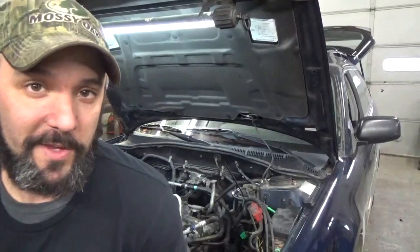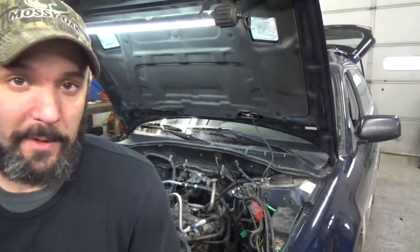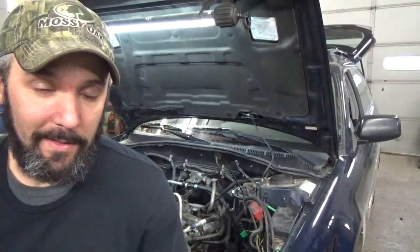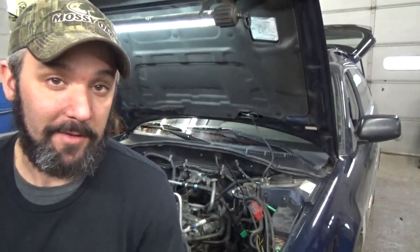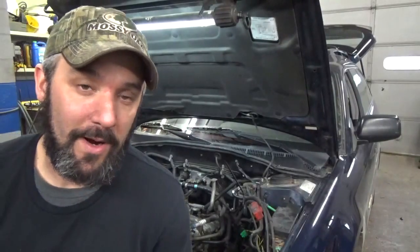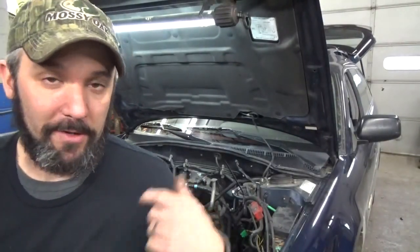So that's really one of the first things I like to do. Heads are off, everything's a mess. There's crap all over the engine compartment. You haven't cleaned out any of the water galleys, the cylinders, or anything. Everything's still all dirty and covered in stuff. So just like you're washing a car, work from the top down. Same thing here: just blow all that crud out, even the stuff up on the cowl.